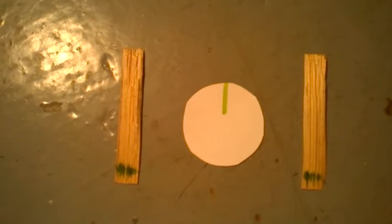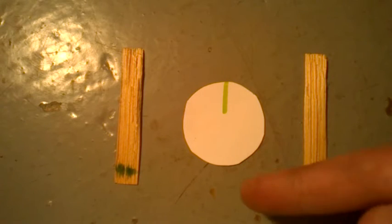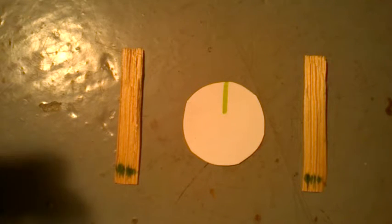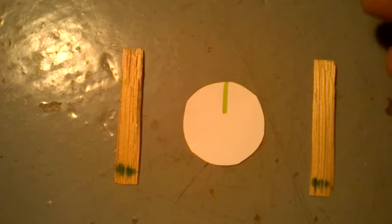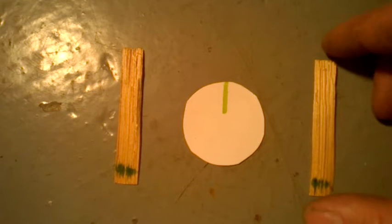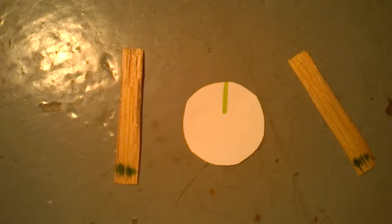Just to show how the geometry of the car works — let's assume these are the wheels, this is the steering wheel, this is the rear and front of the car, and the rear and front of each wheel. Each wheel is connected to the car by the suspension, and the suspension has bushings. Those bushings, usually when you hit a pothole, will turn a little bit and the wheel will change its orientation. I'm going to exaggerate all movements, but this is how it works — let's say you hit a pothole with this side wheel and the wheel will remain like this. It's exaggerated, but at a smaller scale that's what it does.